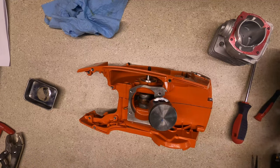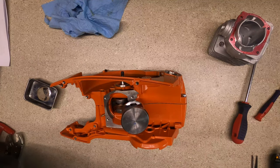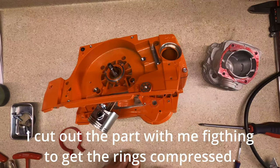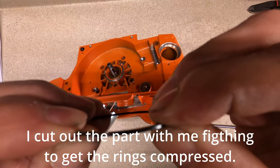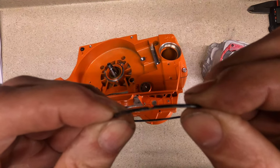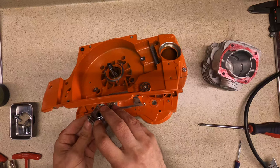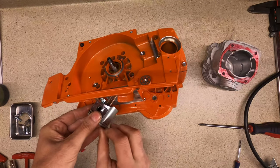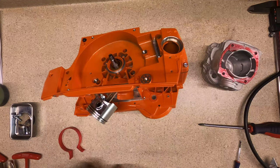You really don't want to make a mistake and forget the circlips and have it end badly. Now we've got our four cylinder bolts. If you look carefully at the rings, they are beveled on the ends so that when they come together they go around that dowel pin down in the ring groove. I think that was my issue — you've got to make sure that bevel is up so the ring can go underneath that alignment pin in order to press completely. So we'll try this a third time with hopefully the rings in the right orientation.